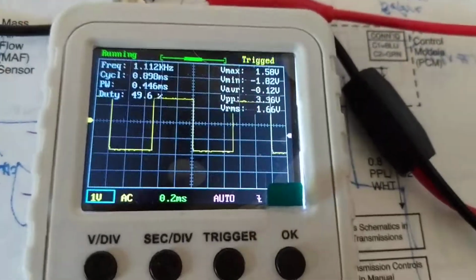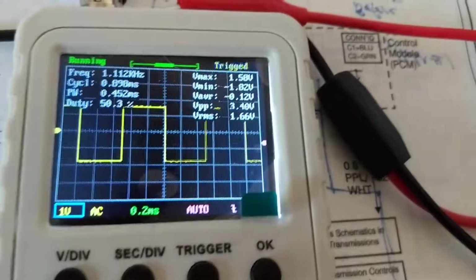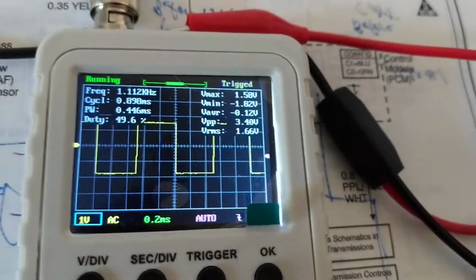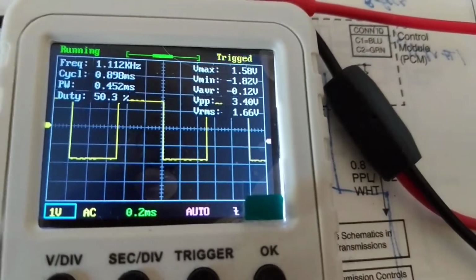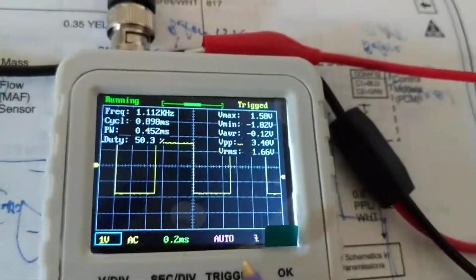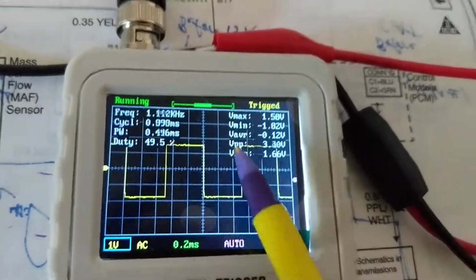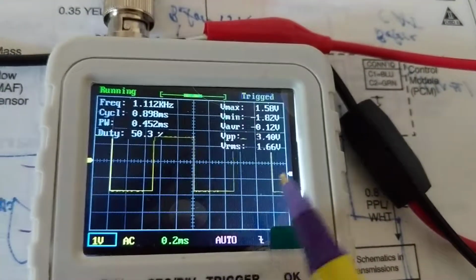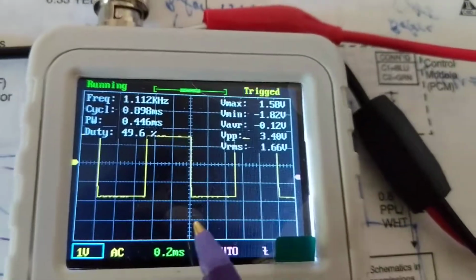Therefore, you have to use a scope. Then you're going to ask me, what about the AC from the outlet? That's a varying signal. We don't use a scope for that. You know why? Because you can measure the true RMS of that. But for signals going to computers, this is something totally different. We have to make sure this is a good signal going to the computer. If we have a bad signal going to the computer with noise, guess what? The computer's not going to understand that. That noise is a problem to the computer.